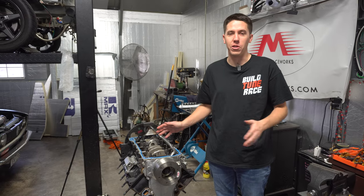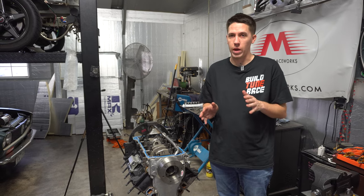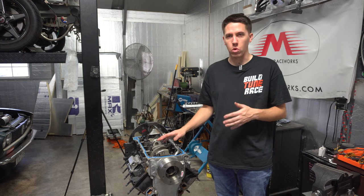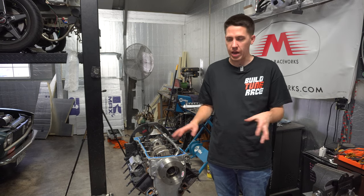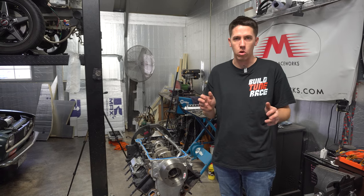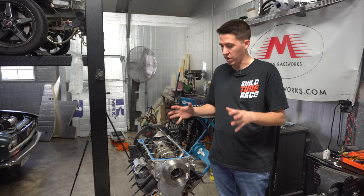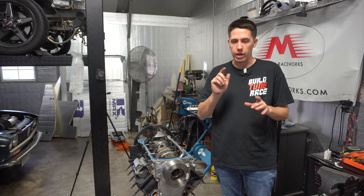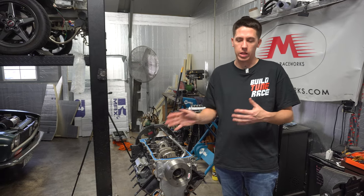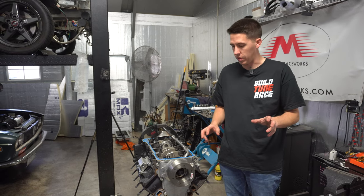It's what we thought it was from the last video, a melted piston. It's looking pretty decent, like the cylinder wall might be all right. So that's pretty much where I'm headed. I got that piston out and looked at it. I think the cylinder wall's okay, but we won't know until it's cleaned and probably at least honed. I don't want to pick at the cylinder wall too much or create big scratches in it. I know some of it's coming off, so I'll let them do it however they want to separate it. Hopefully the hot tank will help remove some of that as well.